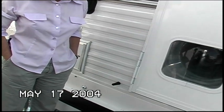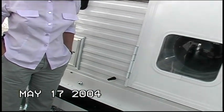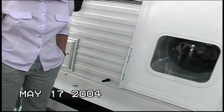On the airbags, no more than 100 pounds. No less than five. If you dump them, you've got to have at least 5 pounds in there. If you don't have 5 pounds in this, you're gonna bust your bags. So what if you don't? They won't leak down, will they? They ain't supposed to.